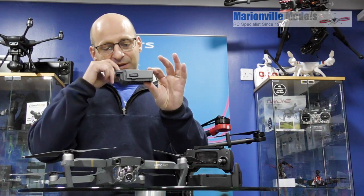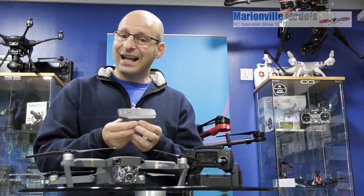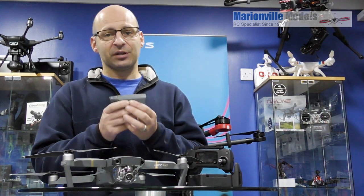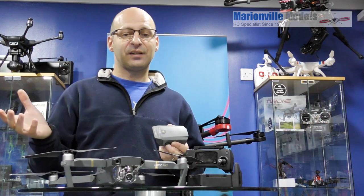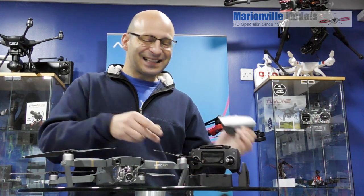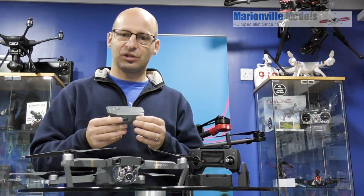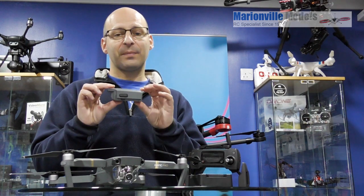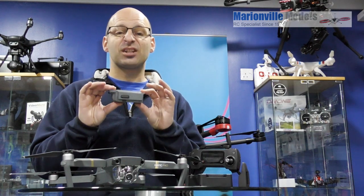The second thing is how to get the best from your battery, how to make your batteries last longest. Lack of use is actually a bad thing, but storage is probably the trickiest thing, because we had a lot of people phone us up in March saying they put their battery away at the end of the flying season, dug it out four months later, and it's no longer working. The most common reason for that is they've not been stored correctly. Two ways you do not want to store a DJI battery: first one is flat, and the other one is actually fully charged. Although the newer smart batteries will actually auto discharge themselves, it's always a good idea to put them into storage charge yourself.